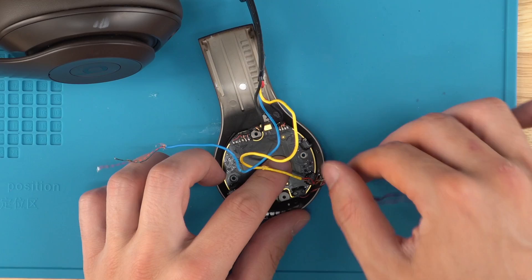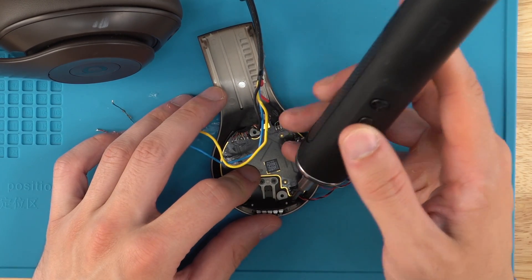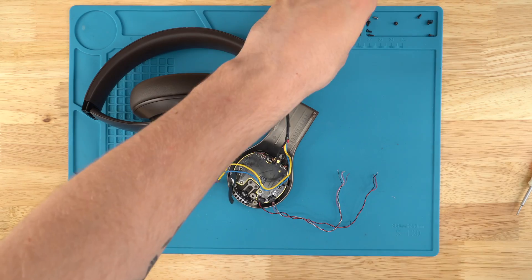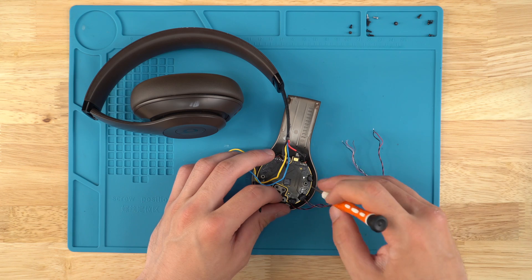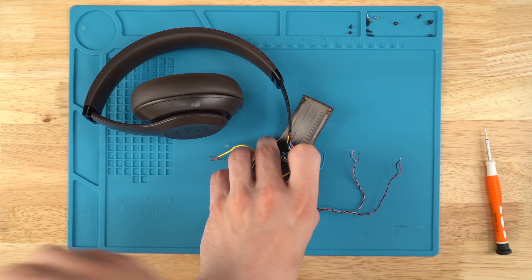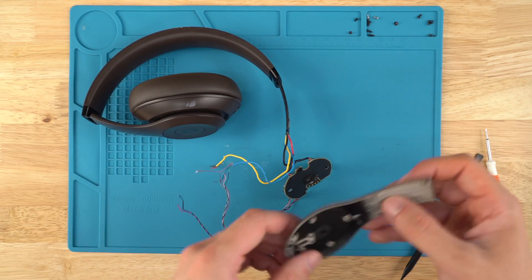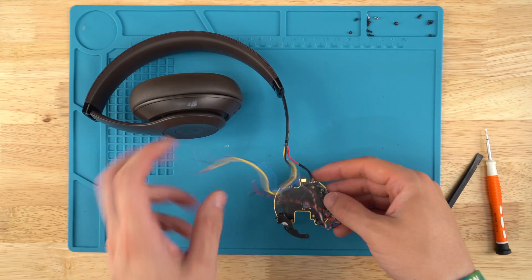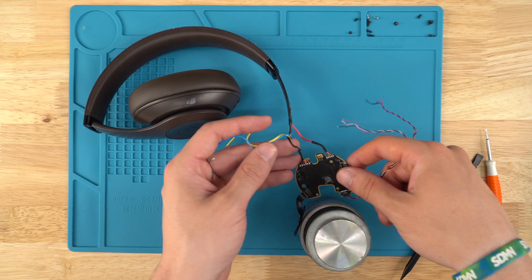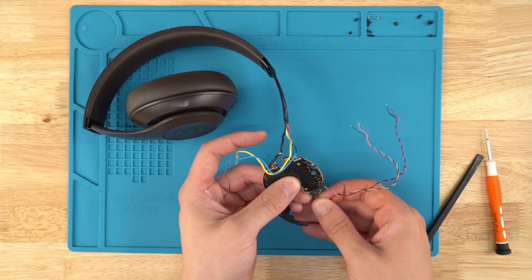We're gonna go ahead and unplug these guys. These will have glue, but let's go ahead and unscrew the LED lights — the LED screws to the side. We'll pry the motherboard out very gently — get the flathead in there and then use our plastic spudger so we don't damage the board. Put the outside panel to the side. I have a vice grip I use when unsoldering boards and PCBs — not necessary but it definitely helps.